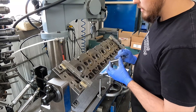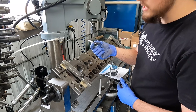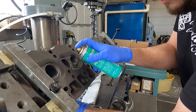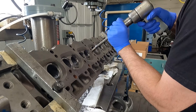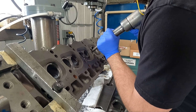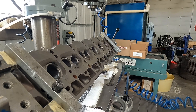Here's one of the guides we're going to be using. Basically what we'll do is we'll drill out this hole and we'll press in these new guides. They are a press fit and then we can accurately size the ID of these guides. Unfortunately the drilling footage got lost, but here we're installing the new guides using the air driver. We're also using Goodson press fit lube to help aid in installation — if you don't use a lubricant it's going to gall and you're not going to have good luck.